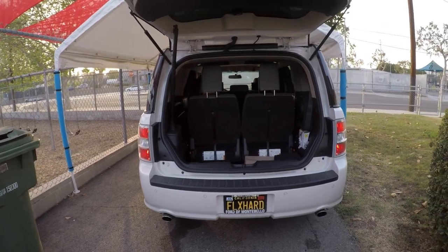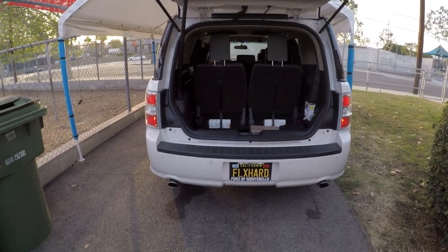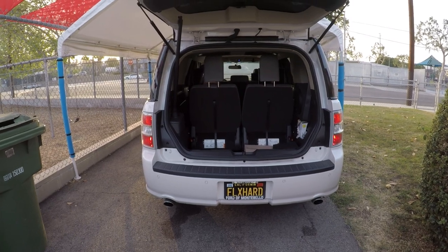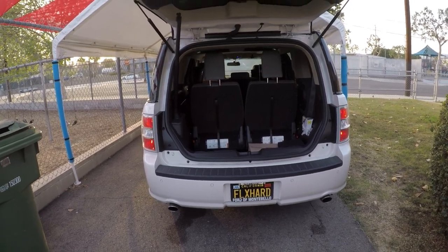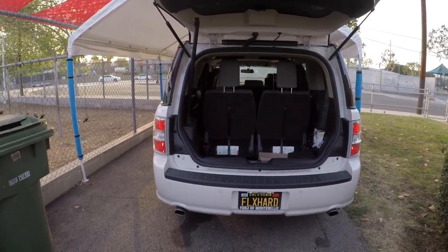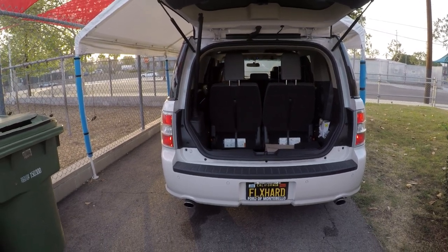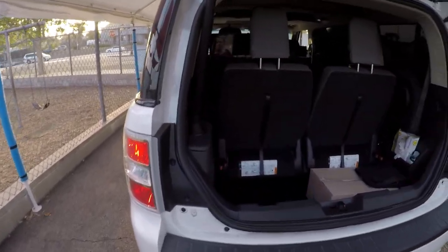So the amplifiers had to be tuned by ear. The front door speakers probably need to be dropped a decibel or two on the gain. But overall, the system sounds really good. However, I do feel like it's overpriced. The subwoofer is kick-ass for a tiny box with the 10W6 V3 in an HD 750 — it sounds a little overpowering, so something like a 500 or 600 watt amp would probably be more than enough.